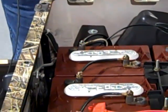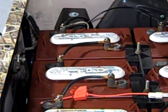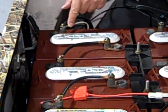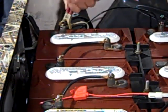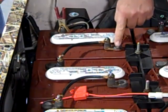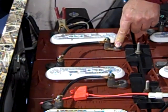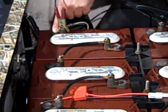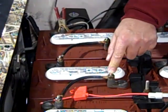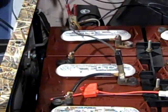So now we're going to hook this up. It's a 12-volt charger. If you've got a 6-volt charger, you can hook it up one battery at a time, but most people can only get a 12-volt charger. So you look for where it says positive. See where it says POS on the battery? We're going to hook up the red one on the POS. Now the next terminal says negative, but that's only 6 volts. If we want 12 volts, we've got to go to the negative on the next battery over, so you follow the wire — positive, negative, positive, negative. Now we've gone from positive to negative, so we can plug in the charger and it will charge those two batteries.